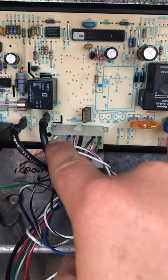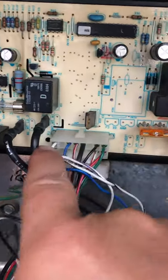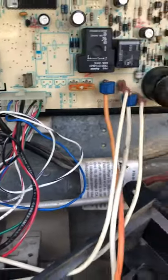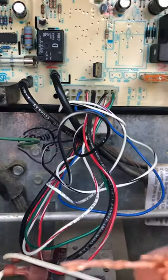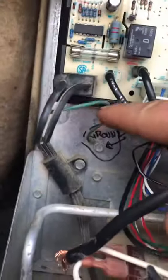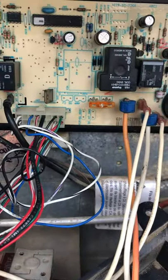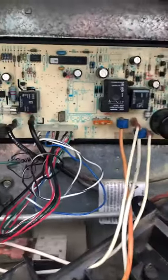So this would be 16 — counting to the 16th one. It's the far top right — that's purple. They call it violet and white. The one next to it is empty. You take this wire, you've got to make it really thin and stiff and get it deep enough in there. Put it in there and then touch the other half to this ground — see this green wire? Touch that, and put this piece in there and hold it there. Between 10 and 15 seconds, you'll hear a distinct click, one or two clicks. And that resets the whole unit.